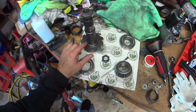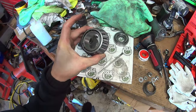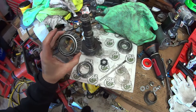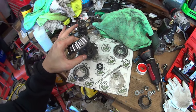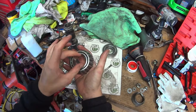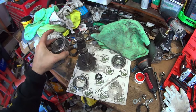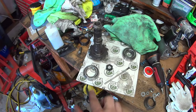Alternatively, there's a trick you can use. If you put the pinion in the freezer overnight and put the bearing in the oven at 350 degrees for about an hour, supposedly it just drops right on — warm metal expands and cold metal shrinks, and that's just enough clearance difference. We're actually going to try that.